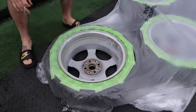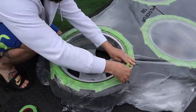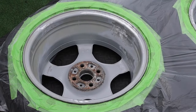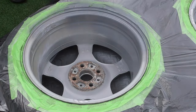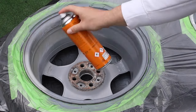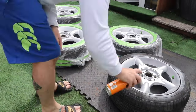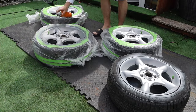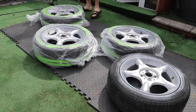When I'm masking up I've got this big sheet I can use — if you don't have that, just get yourself a bin bag, it does the same job. The reason you're using etch primer is that it self-etches into any bare metal areas and it's going to prevent any paint flaking off. I haven't masked up that one wheel because the tyre's burst and it's going to be replaced, so it doesn't matter if I get paint on it. Once you've done the back areas, flip the wheels round, get the faces, and then we should be good to go for paint.